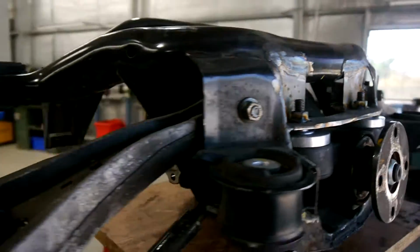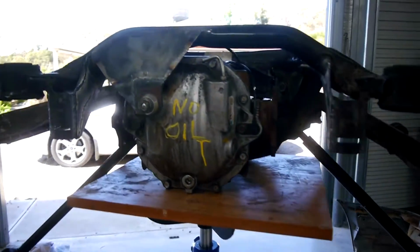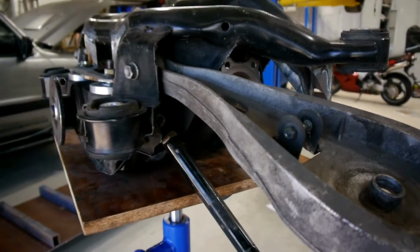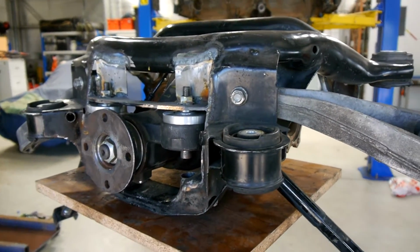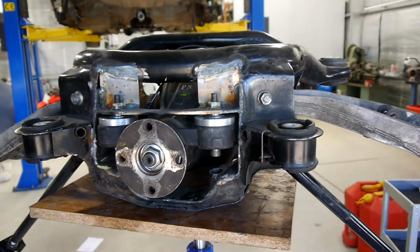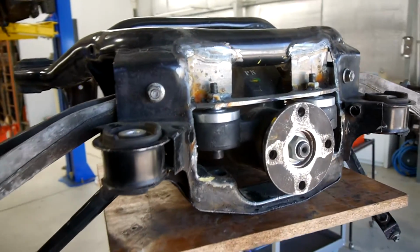And then things like making sure there's enough room in between this rear stud and the back of the wheel well for the spare tyre. So those are things that you need to keep in mind, as well as things like pinion angle. If you're not sure what pinion angle you should use or how to measure it, have a look online, but also go speak to the person that's going to be making the tail shaft. They should be able to give you a good idea. It's going to depend on which gearbox you're using, how you've placed it, and all those sort of bits and pieces. So it's going to be fairly unique to you, so you want to make sure you get it right.